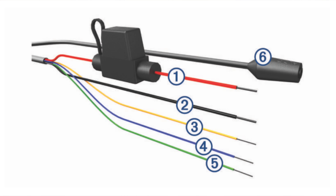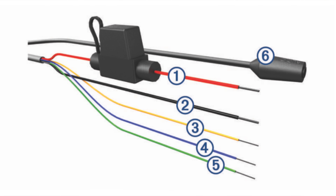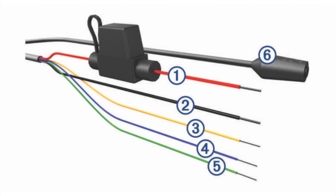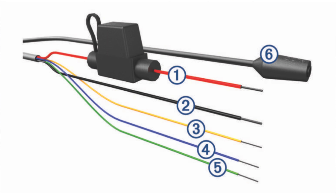The cable contains a lot of wires. The plus is the red one — quite obvious because the fuse is mounted to that red wire. You don't need that fuse if you connect to switched power, but you should use it. Don't cut it off if you are connecting to the battery.